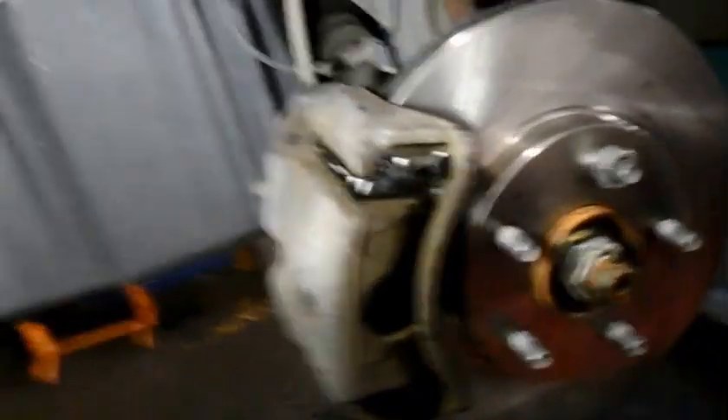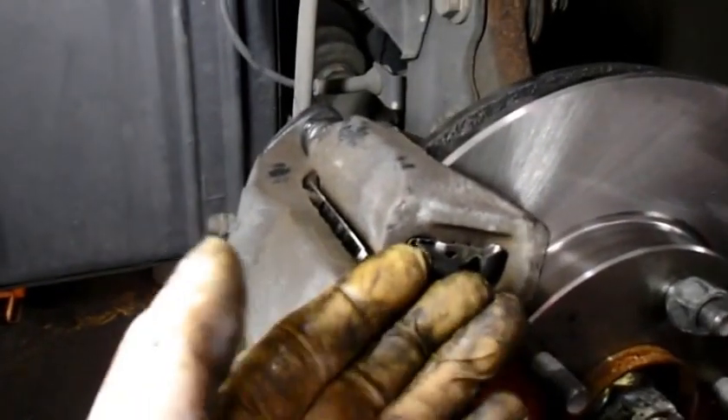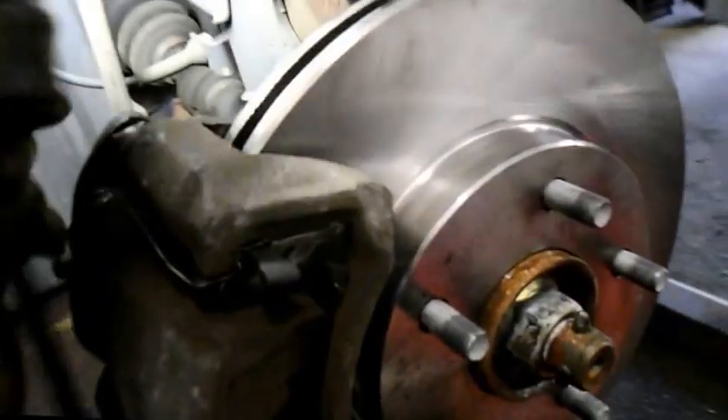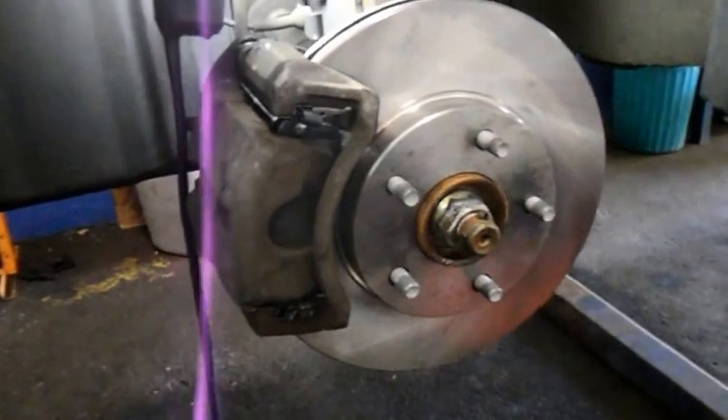Let me go over one more time what we had to do. We made sure we have the new clips in place up on top here, and the brake slider pin is hooked on here so it keeps constant pressure and pulls it away — same thing in the back. We tightened up the bolt on the caliper here and here, and tightened up those 19mm bolts in the back. Last but not least, take the nut back off, then go to the other side and repeat the process. Before you drive it, just pump the brake up inside the car — it'll have a nice firm pedal and you'll be good to go. Thanks for watching, any questions or comments drop me a line. I'll see you on the next one.